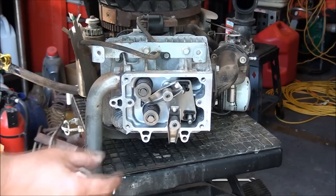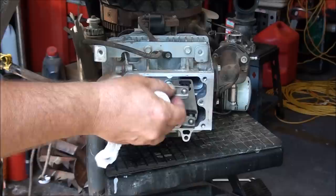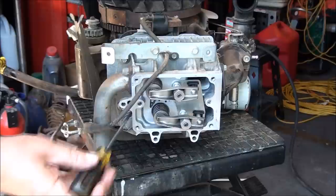Make sure there's plenty of oil all over the place in here. Put the rocker arms on. We'll adjust these stinkers. To adjust these valves, we have to find top dead center on the engine. To do that, I have the spark plug removed and I'm going to stick a screwdriver down in here just so I can monitor where the piston's at.